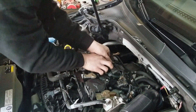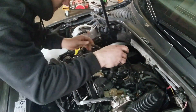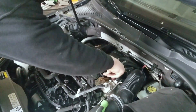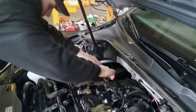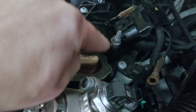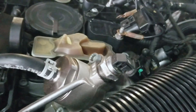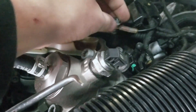Tech tip: don't plug them in until they're all done. Word to the wise — don't plug them in until they're all in, since they're lined up in a row. It's just easier to pull all four down at once — saves you some hassle. This can definitely be done in your driveway. You just need a spark plug socket and a 10 millimeter, and maybe a pick to get the snaps off. The long bolts go into this spot here, and the grounds come back over top.